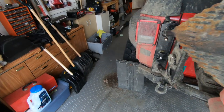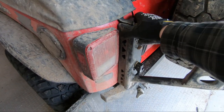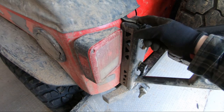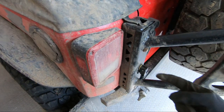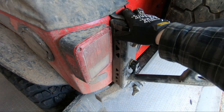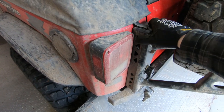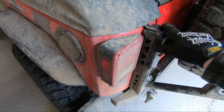The other thing I'm going to have to deal with is my Poison Spider tire carrier — this has a bunch of holes drilled into the corners of the body. So I'm going to have to make sure that when I'm putting these rock skins on, I mark holes from the backside and drill through the rock skins to be able to mount my latch plate back on. That will vary a little bit depending on what tire carrier you're using — when we get into installing the corner skins, I'll show you guys how I do it on mine.